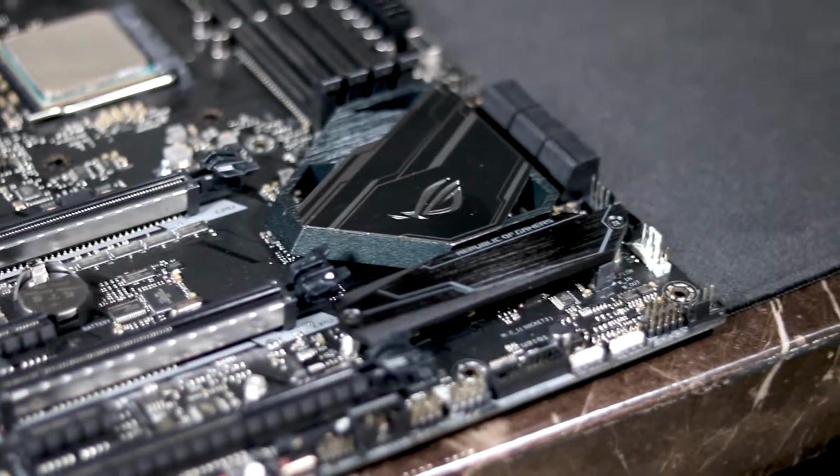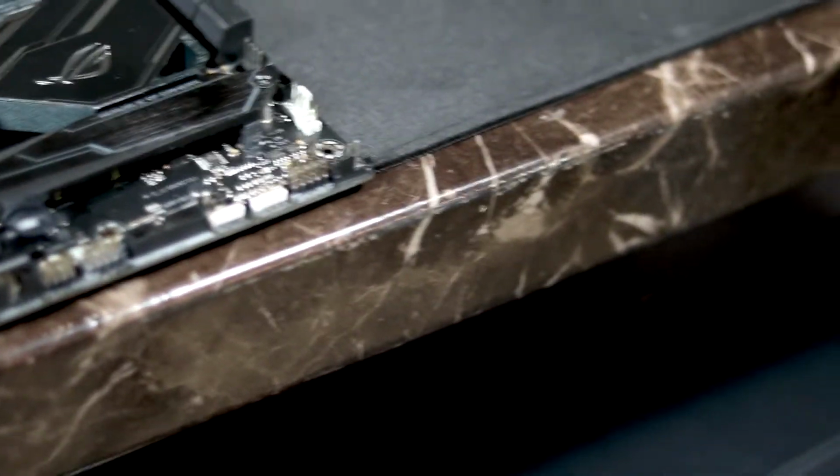Therefore, I had to adapt one of my USB 3.0s to USB 2.0, which meant I had to get an adapter. Not to mention, the way that my motherboard is placed, that USB 3.0 port actually does interfere with the extra thick radiator. Meaning, I had to get a 90-degree angle adapter to make sure my USB 3.0 ports could get plugged in. Front panel headers, of course, are super simple, but unfortunately, the angle of the USB 3.0 makes me believe that Lian Li should have invested in doing 90-degree ports instead of the straight ones that they did.